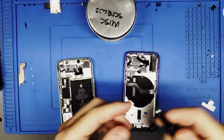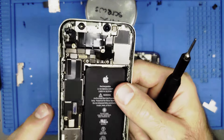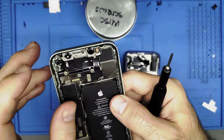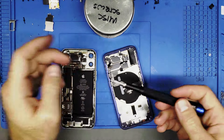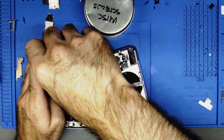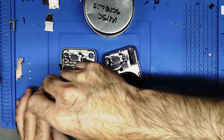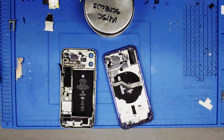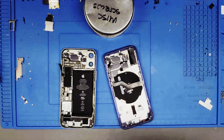I've got to take out some more screws for the camera module, so let's do that next. There's not a lot of screws that need to come out for the motherboard — just a couple at the bottom, plus some screw-in-screw style — looks like three. Before I start on anything else, I'm going to disconnect all the ribbon cables first. When taking out motherboard screws specifically, you really need to make sure they stay in their proper order, as some may be slightly different sizes.